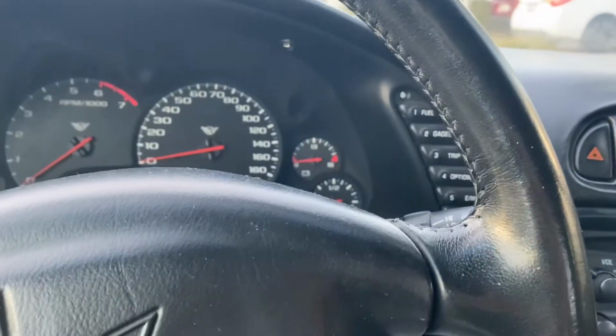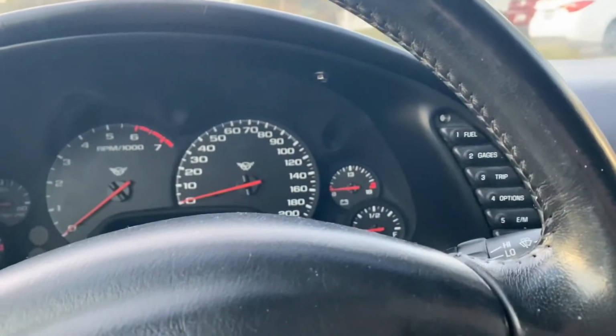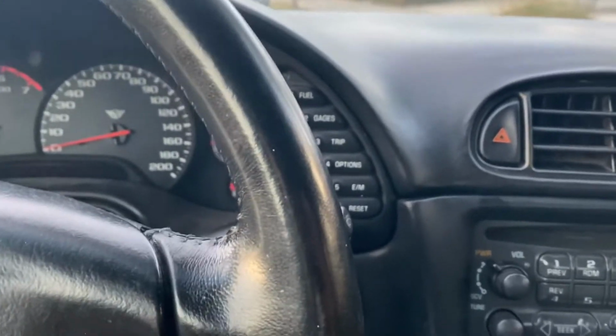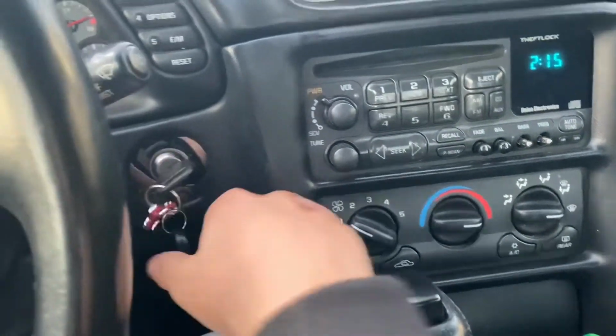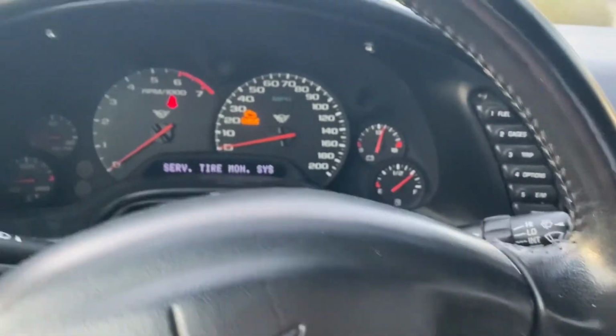It's Peter, now back with another video, and today I'll be showing you guys how to diagnose a check engine light. Alright, so step one to diagnosing a check engine light is to go ahead and put your key in and turn your car on. Make your car's accessory, all electrical stuff on, but do not actually start the car.